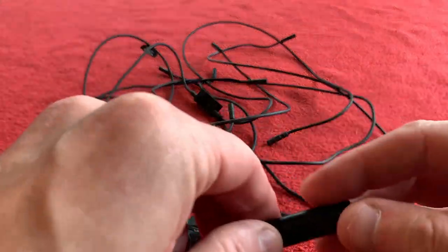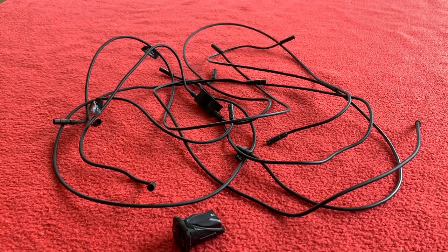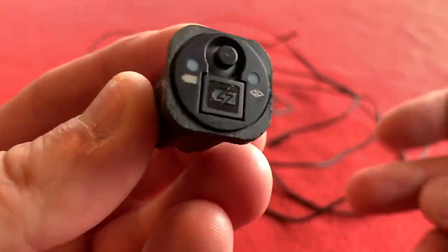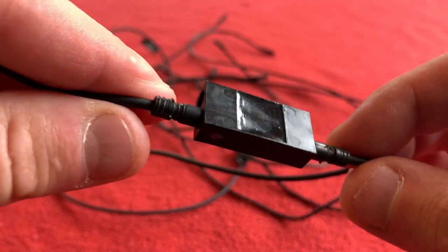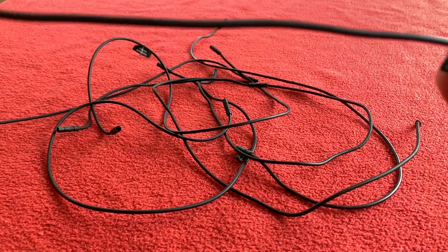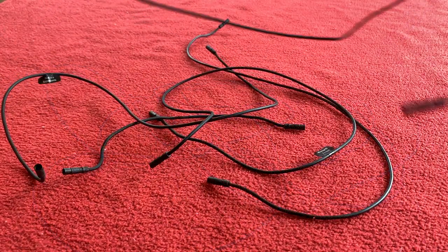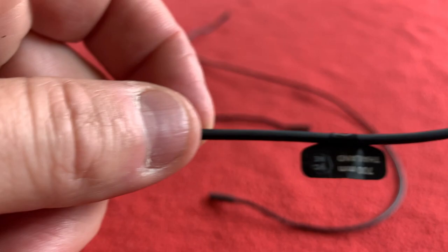First up we've got the electrical parts. We have the inline EW-WU111 controller — Bluetooth, I believe. Then we have the Shimano EW-RS910 junction box that is going in the frame; it was in the end of my handlebars but it's now going in the frame of the R9. We have junction box A, the SM-JC41, with electric cables coming off it. We have a 350mm, one with no label that looks to be about 750, a 650, a 700, a tiny short 200, and probably a 500 — seven electronic cables in total.